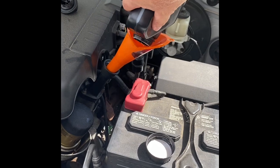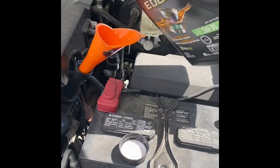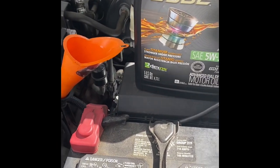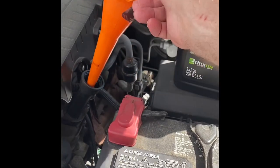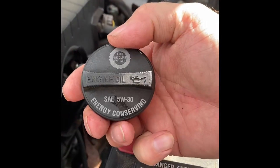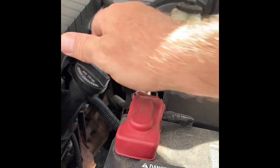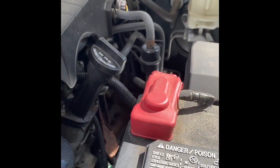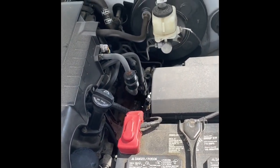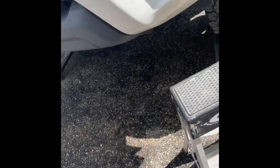My camera timer shows the total oil change footage was about two minutes and 37 seconds — about two minutes of actual work. Now put the cap back on. If you ever forget, it's SAE 5W-30. Don't check the dipstick right now because you're elevated and just put the oil in. Make sure you've got nothing on top of your engine or in the grooves — that can be deadly. Drop your hood, take the car off the ramp, and don't forget to remove your chock.